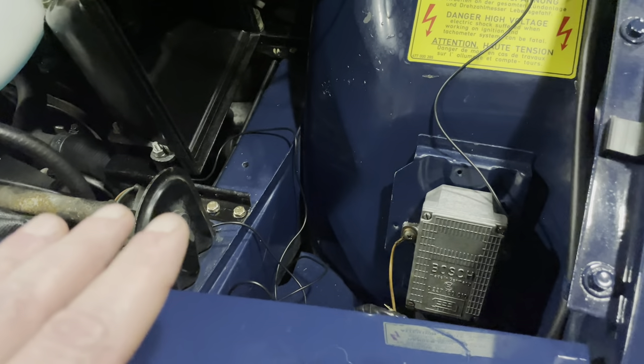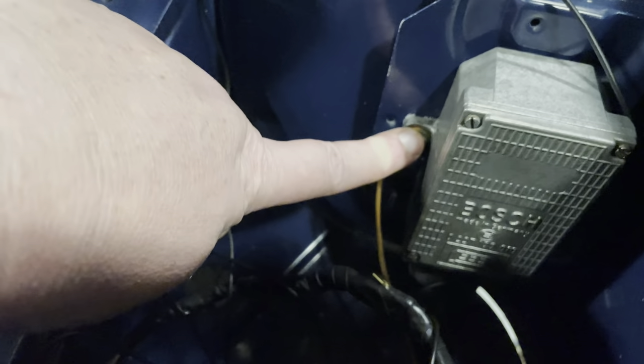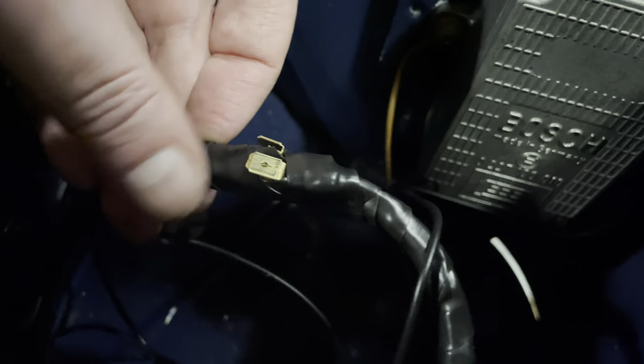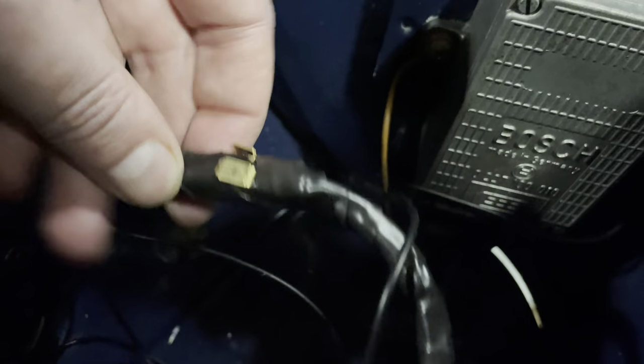So I'm making progress — it's really slow and I'm really overthinking. Forgive me for not filming everything because it's difficult to film and think at the same time. But this has been cleaned up, the earth has been cleaned up, it's got new screws through it on both sides. I've now wrapped this wiring harness because I couldn't get a sheath that goes over it properly. It's been plugged back in and those pigtails have now resulted in this little solution of piggybacks that stick out through the wrapping — one is for the dims and one is for the brights. So one of these will go to power the spots and one will go to power the fogs.